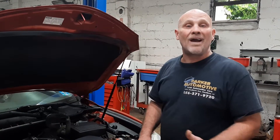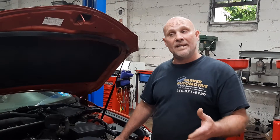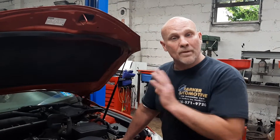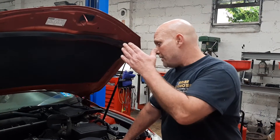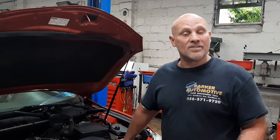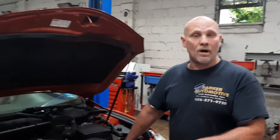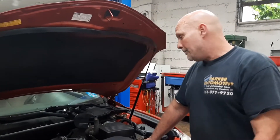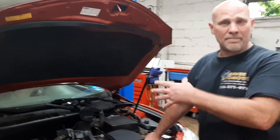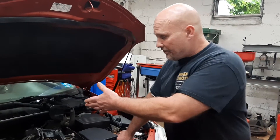This car has a weird rattle already without the variable timing issue. The motor is compromised. The number one problem was a wiring issue, and that was handled. But going further, I realized there was a mechanical breakdown. That's after testing — because I don't just replace parts, I test all the components. And that's when I found they were all good. I was getting some weird information back, but that's because there was either no oil pressure or the phaser was bad.